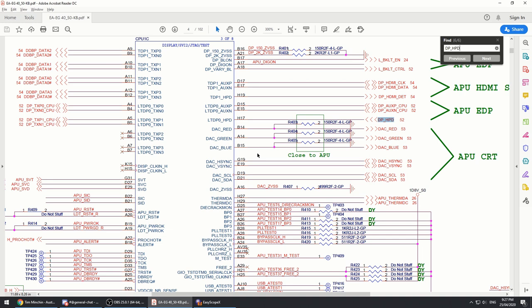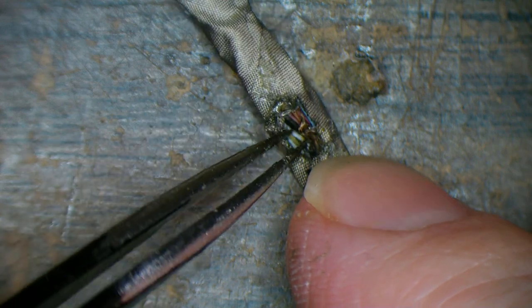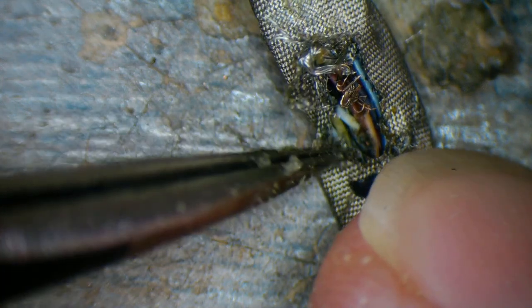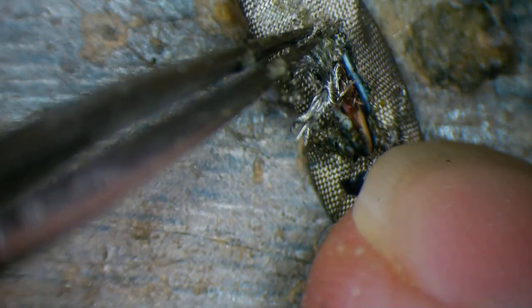I think we have an LCD panel problem - it'll be on the control board in the screen unit itself, or the loom has broken in between so the signal can't get through. Maybe in the hinge itself the wires have finally broken. And I was right - as I started peeling this back we have broken strands sticking out. It's definitely let go, and it looks like possibly more than one. There's what looks like an earth wire wrapped in conductive cloth braid acting as a shield.